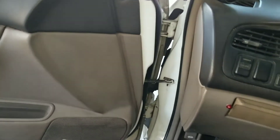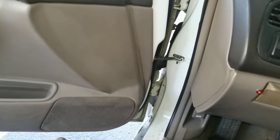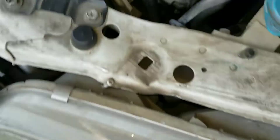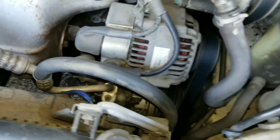The only other thing I've got now — and this has been going on for a couple of years — I think I have a bad bearing on the AC compressor. As soon as I turn it on, you're going to hear it — that compressor just clicking down there. I mean, other than that it's running fine. I just don't like that sound. If it's a bearing it can get jammed and the belt can rip off.